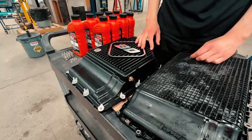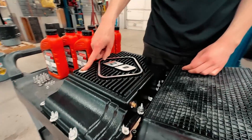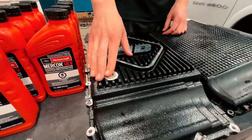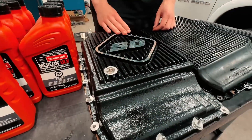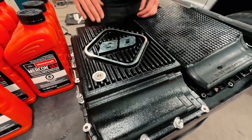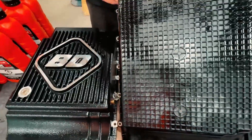It comes with a port, so if you're not using it you can just plug it up and don't have to worry about it. Big thing: it adds a drain plug for you, so you don't have to go through the whole pull-the-pan process in the future if you want to do a fluid change. It also has these big old ribs on it for cooling, while the stock pan just has this little hatch on it.